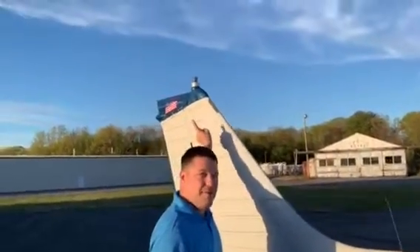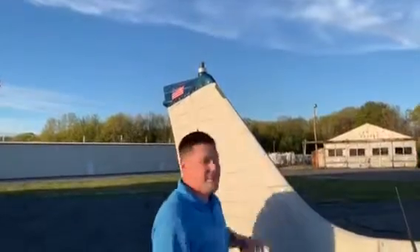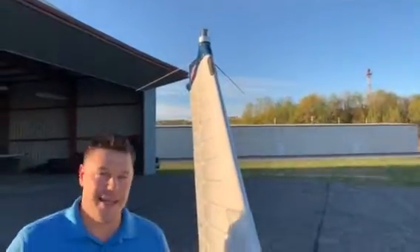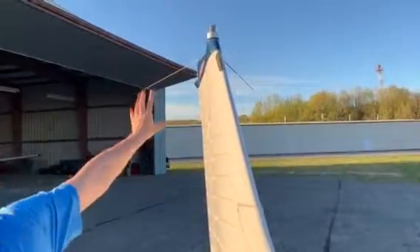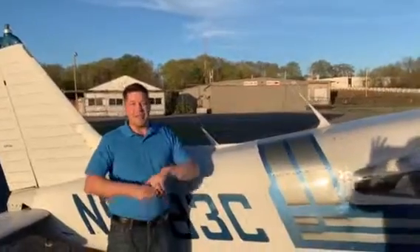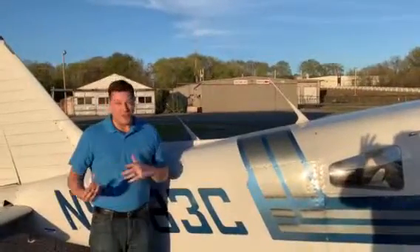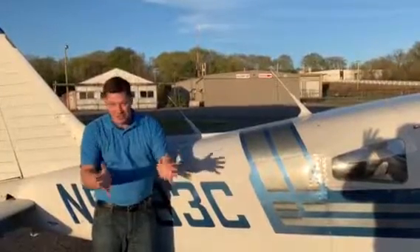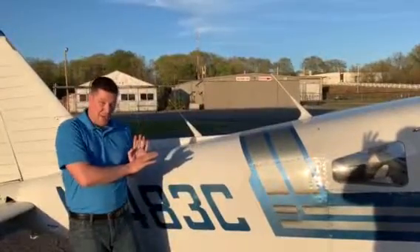The top of the aircraft and the top of the vertical stabilizer are the VOR antennas. You can remember those very easily because they're shaped like a V — that stands for VOR. They better pick up a VOR signal by being in a horizontal plane than the COMs, which are better at picking up communications frequencies in the vertical plane.